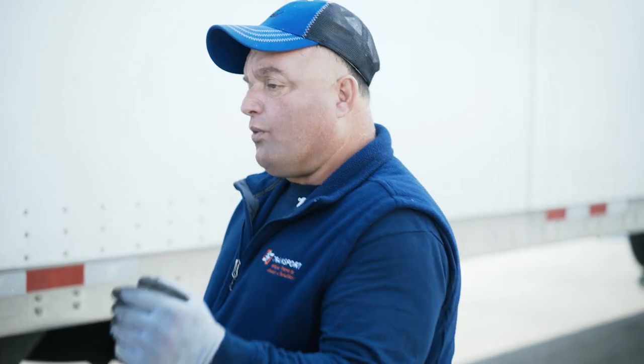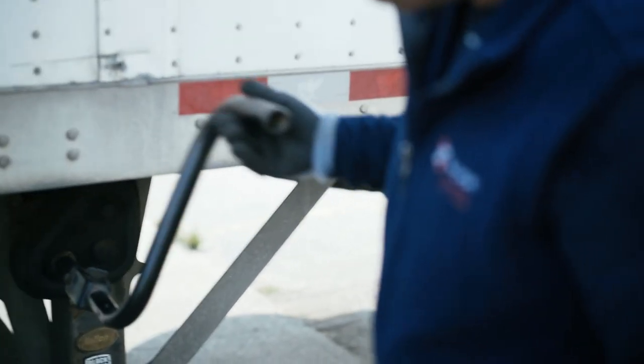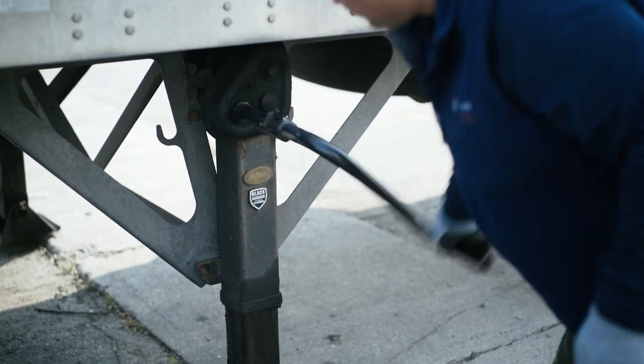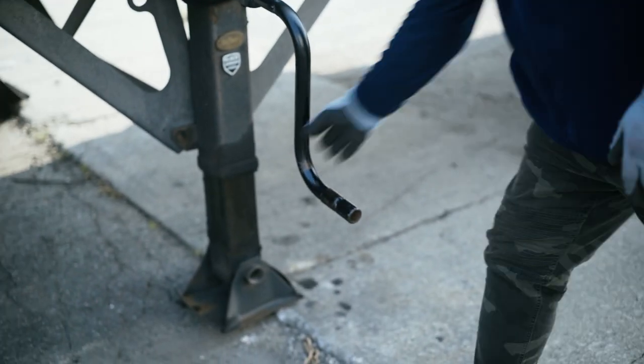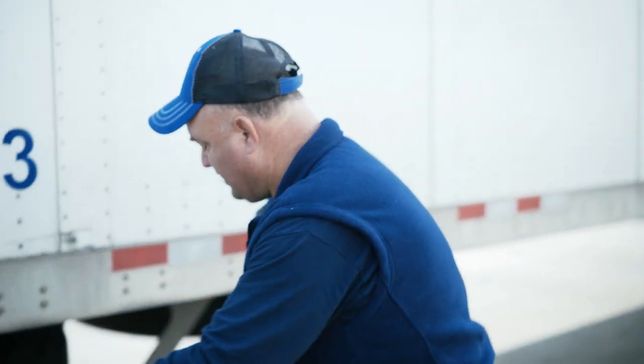The biggest pet peeve I have with other drivers — at any place I've worked — is when they put their dolly legs down, they crank them all the way down to the ground. Leave your dolly legs an inch, inch and a quarter off the ground. When I back under there, I'm not sitting there ripping my shoulder out trying to get those dolly legs up. Please, every driver, leave a little bit of space on the ground — it makes it easier for the next driver when he hooks up to that trailer. If I was to drop this trailer myself, I would leave it about that far, drop my air, let the trailer come down till it sits on the ground. Then when the next driver backs under, that's going to lift only that far — he can crank it with one finger instead of trying to reef on it and throw his shoulder out. It's a good way to hurt your shoulder. Just a recommendation.